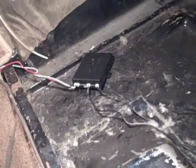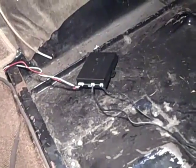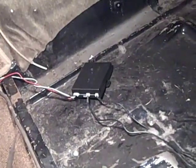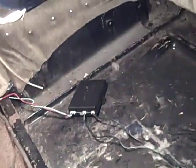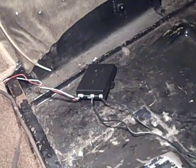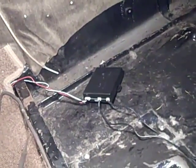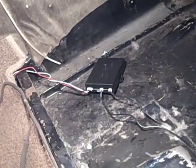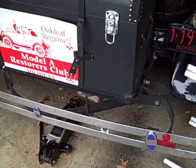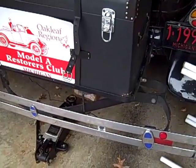There's the control box for it. Coming out of the control box are the power wires and the wire that goes to the beeper. The two wires that go out to the sensors go out through that little hole there. I've got to clean up all this, but I've put the control box under the rear seat, routed the wires forward to pick up the 12 volt supply that also supplies my CB radio. I routed the beeper from the control box under the rear seat up to under the front seat — I'm sure it'll be loud enough.